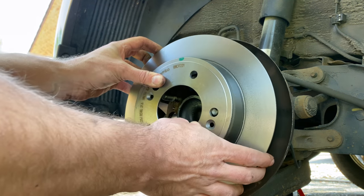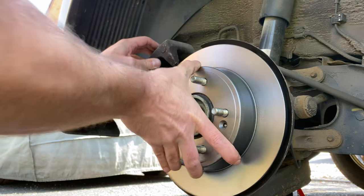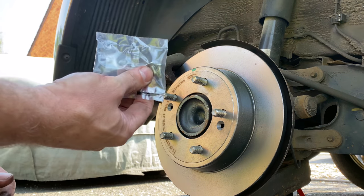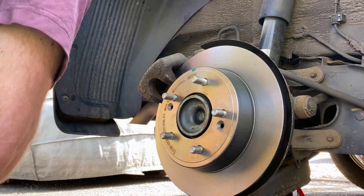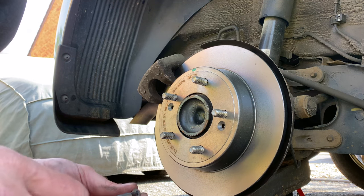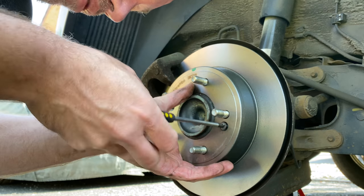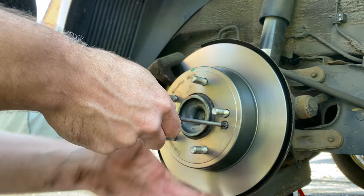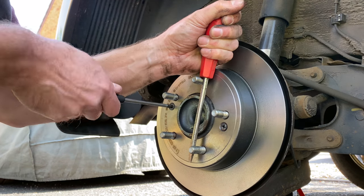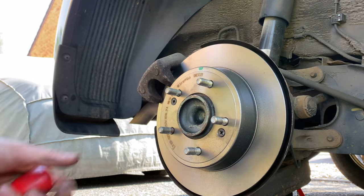Put that the right way around. Usually they give you brand new screws, which they have. Now annoyingly, they've given me two screws for a car that has four. I guess they're expecting you to either reuse one or only use one. In all fairness, you only really need one, because these don't really do anything other than just keep the disc in place when you're reassembling things. They don't need to be overly tight, just tight enough that they ain't going to slip off after a few heat cycles.